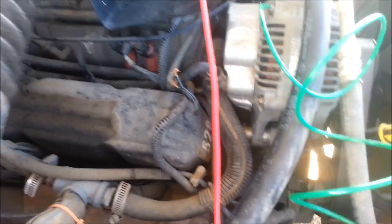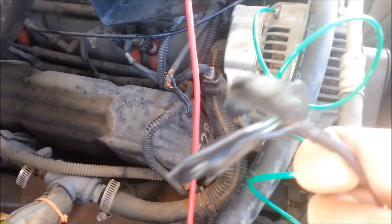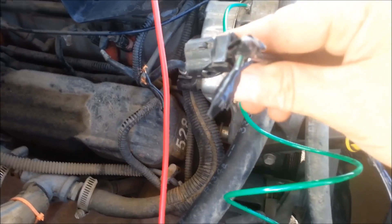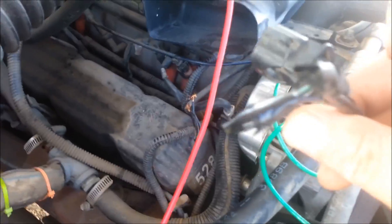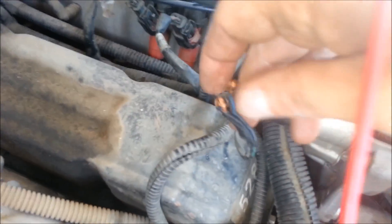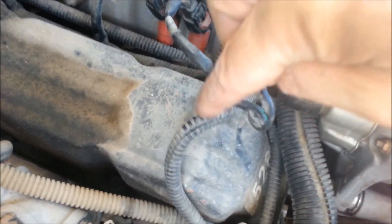As far as the connectors go, I had to cut the existing one and put the new ones on, because the kit didn't come with connectors for this vehicle. Basically to run the two wires — the two black wires coming up here — this big one gets left alone. These are the old wires going to the computer, which I'm just going to separate and tape off.